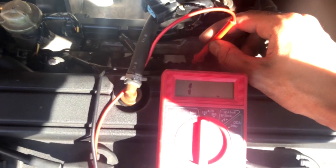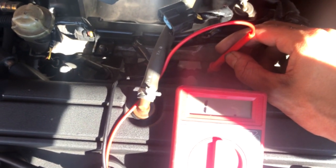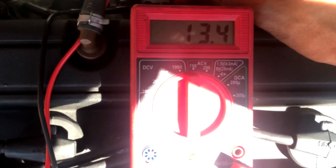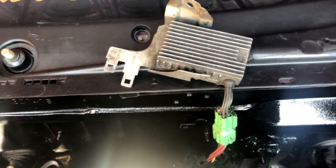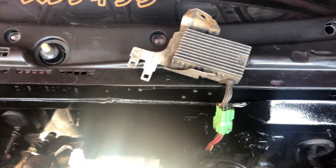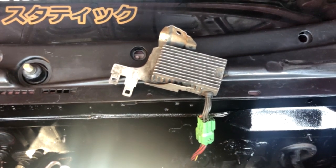Let me go ahead and show you what I found on the car. For those of you who watch my videos, you probably know I'm having an issue with this car — it is running super lean. I just checked right now and it turns out the previous owner wired in these OBD-2 injectors and pigtails. When I check for resistance on them, I'm getting 12 ohms across all four — 12.8, 12.7. So these are high impedance injectors, also called saturated injectors. And literally if you look up here, I'm still running a resistor box. So I was running high impedance injectors with a resistor box, and I'm thinking that's what's causing it to go lean.